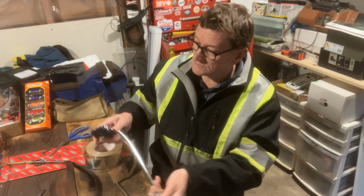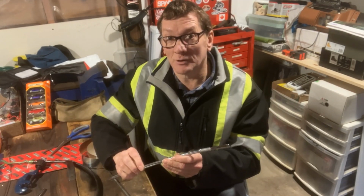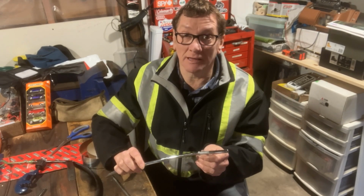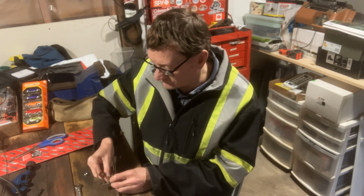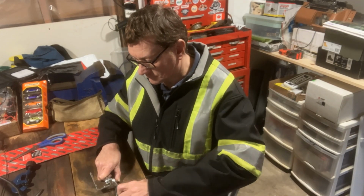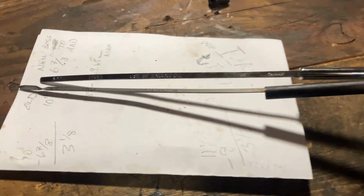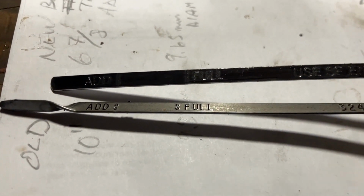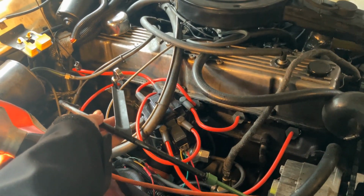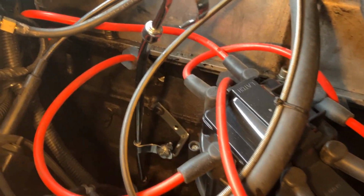And with the tube cutter, you always cut into the roller. The blade follows. Then when putting it in the block, I'm hesitant to have any aluminum foil fall down into the pan. There you go, as simple as that.